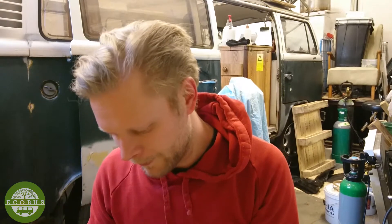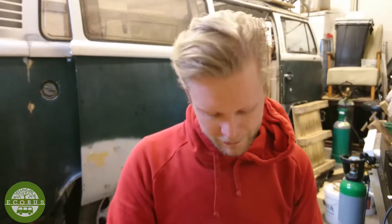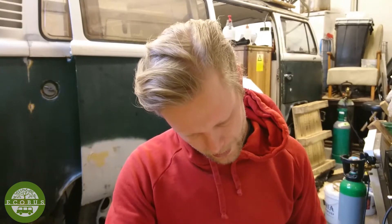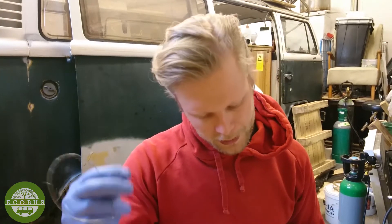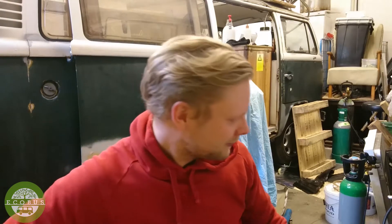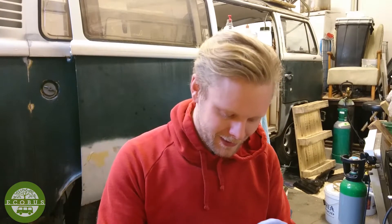And this time, here's the new resistance wire. This is 40 AWG — 70 ohms per meter — so it should be proper now. I just spoke to a friend on the phone and he asked what I'm gonna do now, and I said I'm gonna wrap resistance wire around a tiny red part. Isn't it great working with old cars sometimes?